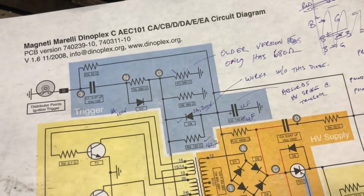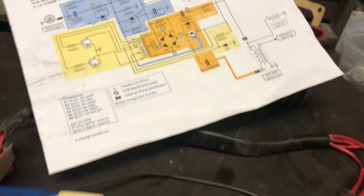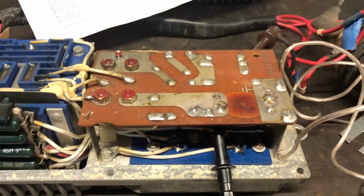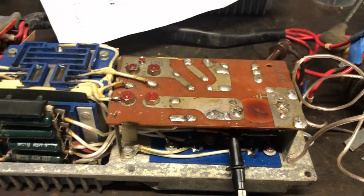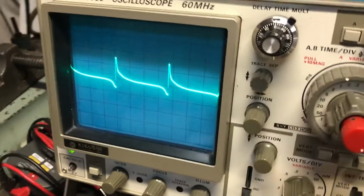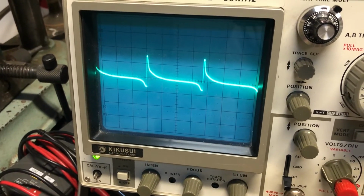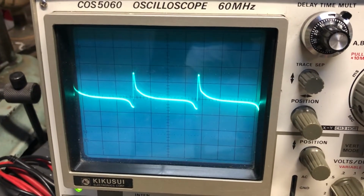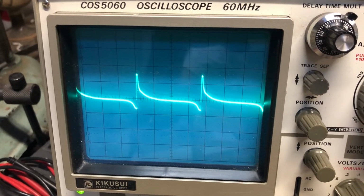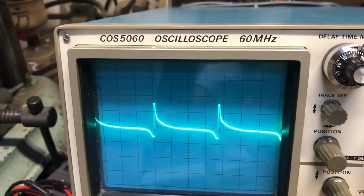Yeah, this is measuring between points N and G. And G is the probe and N is the reference. Yes, that's correct. Okay, so I turn this on and I see something I didn't expect. This is a ringing on the ground. That's at 1 volt per division, so it goes negative a little bit and then up about 1 3/4 volt. That's with the points closed.